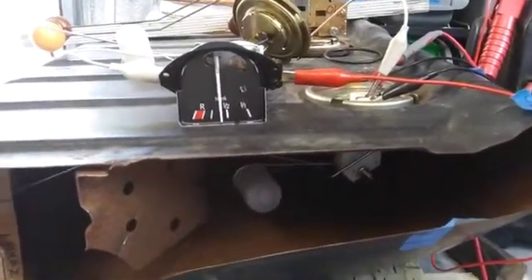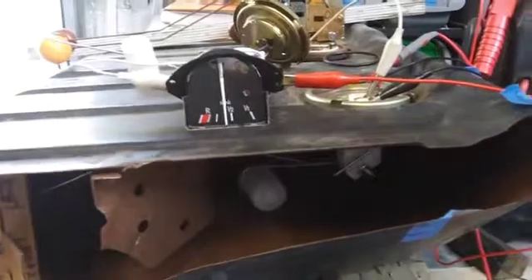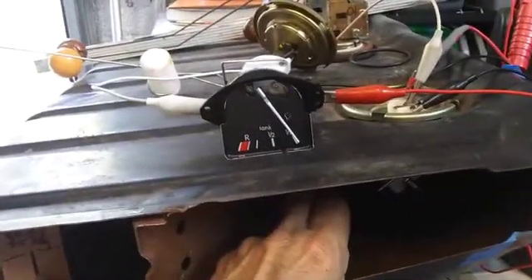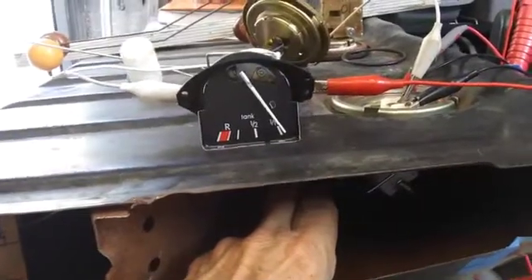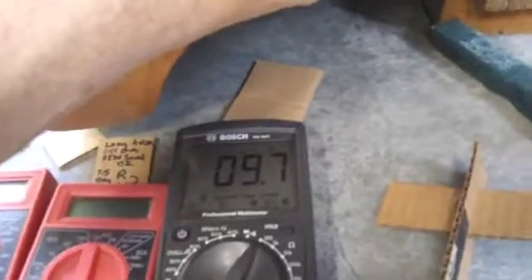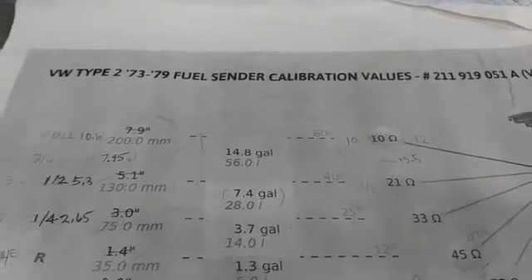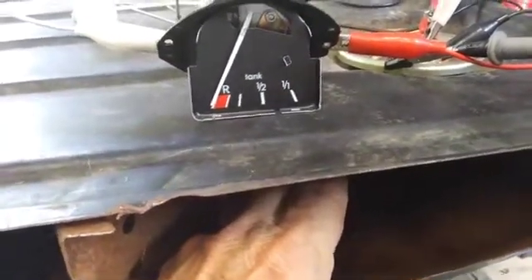I'll do another test to show a non-calibrated aftermarket gauge. That concludes the testing except to show the full tank. This would be showing a full tank, and it looks like it's about a millimeter above full — that's okay, that's good. We're reading about 9.7 ohms, and we know a full tank should give about 10 to 11 ohms. I like to see them more towards 11, and that is why at 9.7 it reads a little bit past the full mark on my calibrated gauge.